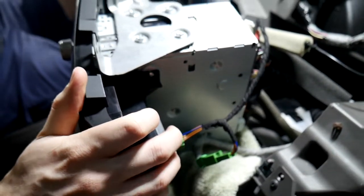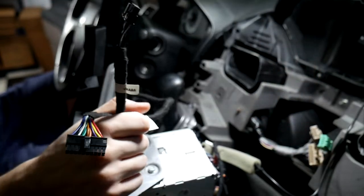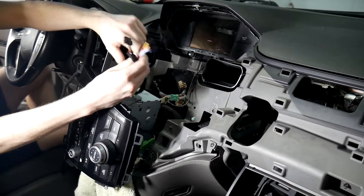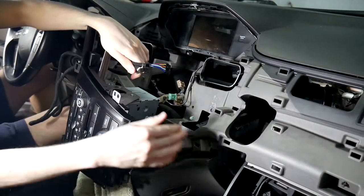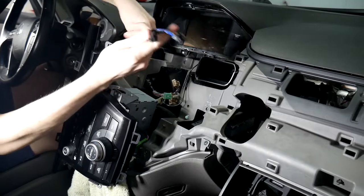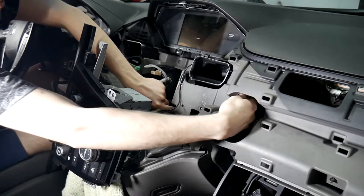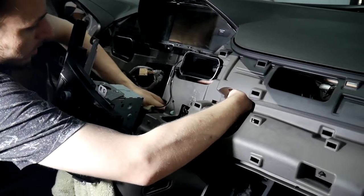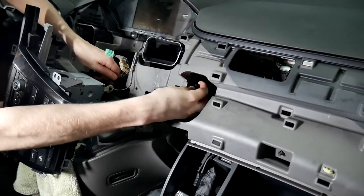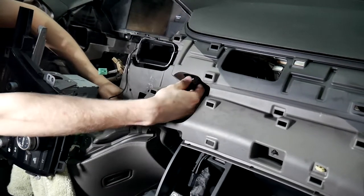For this one we're going to be running the cables to the glove box, running these two cables around through this cavity right here and then straight to the glove box. We've got our two VLAN cables — the display connector and the main power harness — running those to the glove box. Take the two ends and go back behind this piece, your hand can go in this way, and you can just pass them up to yourself. Once you've got them through to this side, don't just pull on them — feed the wire in from the other side so you don't pull any wires loose.